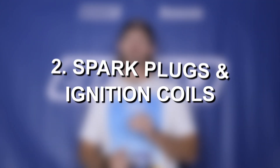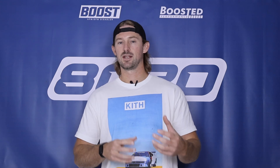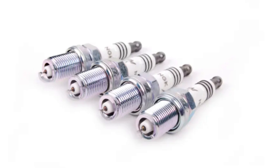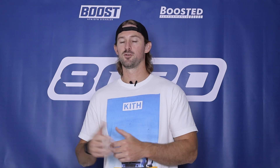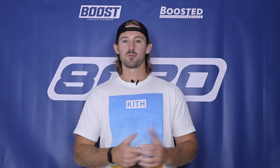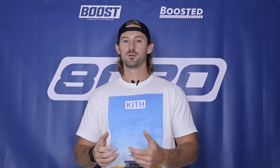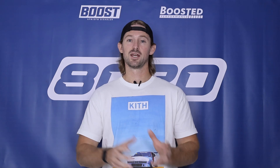Another thing to mention is spark plugs and ignition coils. These are more maintenance items, but once we talk about tuning and adding more power to these engines, they're going to start burning through spark plugs extremely quickly. It's good to run one step colder spark plugs once we start talking about tuning and creating these higher power levels. Trying to do all of these modifications on old OEM spark plugs with 60-plus thousand miles on them is probably going to result in immediate misfires. Upgrading the spark plugs and going with a one-step-colder set — or just a brand-new OEM set — is the best thing you can do before you start throwing tuning and all these modifications on.